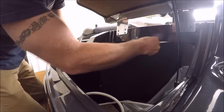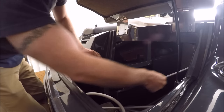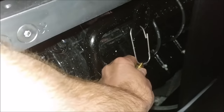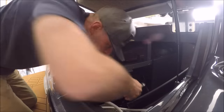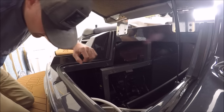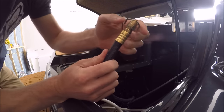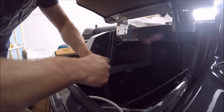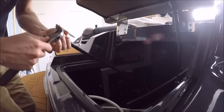I don't need to do anything with that front panel because I have all the access I need. Now you can see I'm looking at the drain hose — it is clipped onto a mount on the motor. I flipped that around so I can pull it off and then removed it. Now you can see I am pointing out a zip tie, so I'm just clipping that with a pair of dikes. I had to get a wrench and a pair of pliers to get this off.